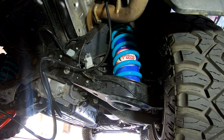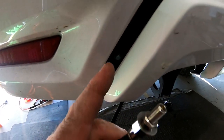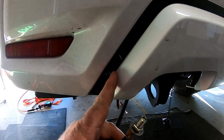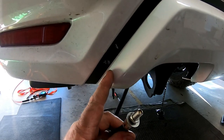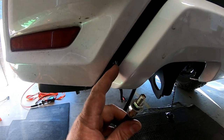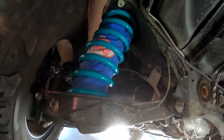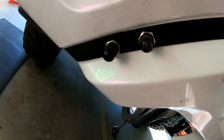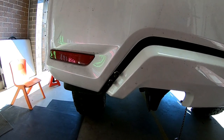I think if you pull the coil out it'd be heaps easier to do everything. Once the bag's mounted and the airline's run, you've got to mount the valves somewhere. For me, I've just drilled two holes in the back bumper and I'm going to put my valves here. This is only temporary - I've got a Razzler rear bar coming, so once that gets here I'll think about how I'm going to mount them a bit better. The other reason I put them here is my air compressor is on the passenger side, so lengthwise I can actually reach this side to get to the valves. Instead of putting the silver valve removal caps on them, I just put some black caps so it blends in a bit better.